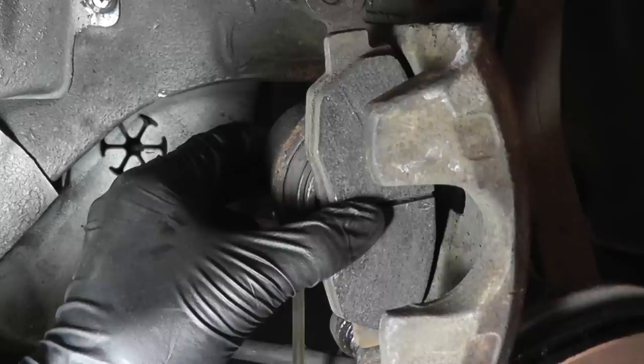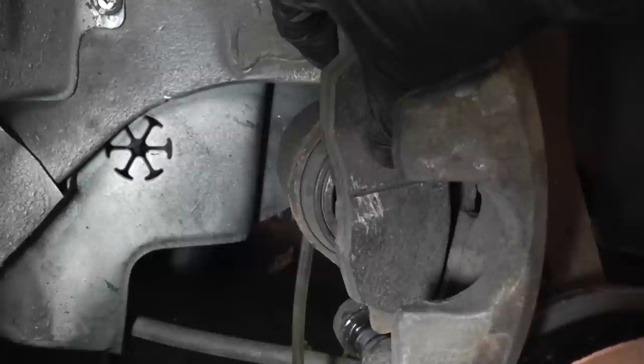To clean it, unscrew the bleeder from the caliper and check the large hole your hose connects to and make sure it's clear. If it is, check the other hole on the side. You can clean up the bleeder with a wire brush or wire wheel on a bench grinder. This hole is where the fluid exits when the bleeder is open. After you're done, be sure to pick up some bleeder caps so this doesn't occur again.